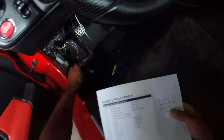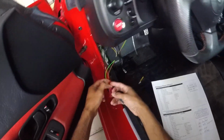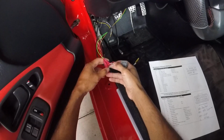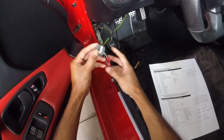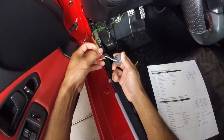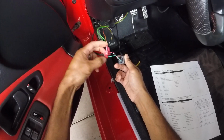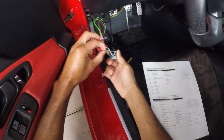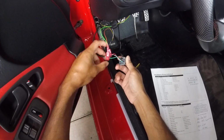I went ahead and disconnected it. So here's the wire that comes from the ID4Motion cluster, and here is the ECU connector, and here's the pinout right here. This is the top side. As you can see, the red one here is connected to this green wire, and that's the D10, the low side. So red is the low side, green is the high side.